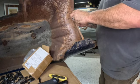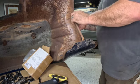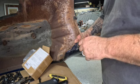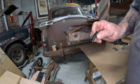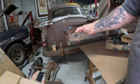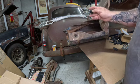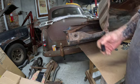These are a little bit of a wobbly feel when they go together on these — I'm going to call them pressed J-nuts. They don't seem to be as stable as the other factory ones I showed earlier, but who am I to criticize when GM used them? This is the three-eighths and it goes in behind here on the car so you can put the three-eighths bolt in with the big washer on there. It may require shimming, it may not, but at this point I'm just going to take care of the fasteners. When it comes time to do the alignments and gap spacing, I may have to shim it.